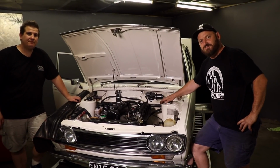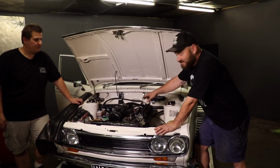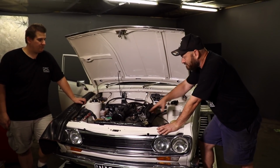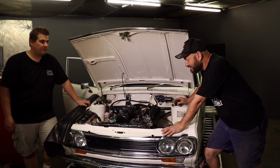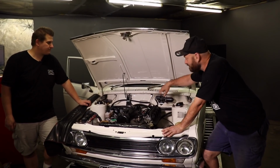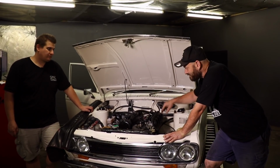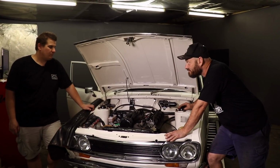We got the Hayabusa throttles on with the custom inlet manifold. Timmy pre-wired everything because he's that kind of guy. Everything just plugged in. We screwed a coolant temperature sensor into one of the spare bungs on the thermostat housing. Jerry rigged up a fuel system, put a throttle cable in that is operating this properly, and we're nearly ready to go. What's next, Timmy?